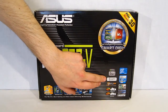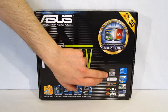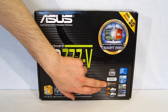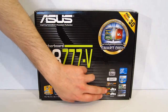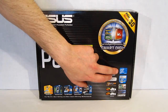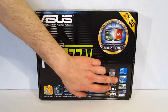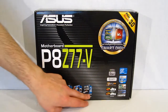The energy saving EPU actually works like a backwards overclock. Rather than you setting the speed you want, you actually set the wattage you want to use and it's going to back down everything accordingly. Moving on, NVIDIA SLI and AMD Crossfire support, LucidLogic's Virtue MVP allowing for hybrid graphics using the iGPU, DTS audio enhancements, Intel Z77 chipset, LGA1155 support, and HDMI output.